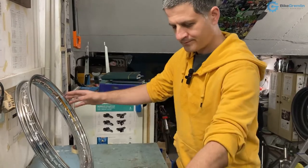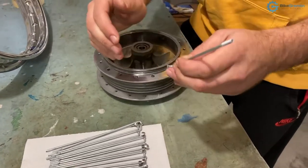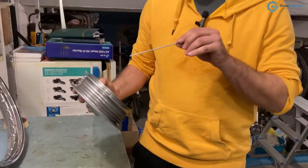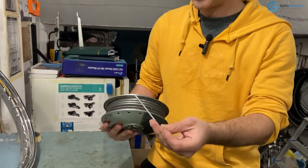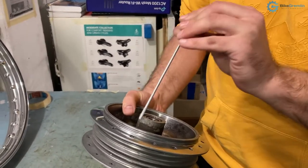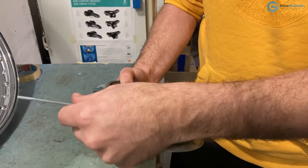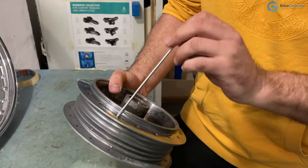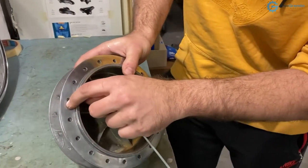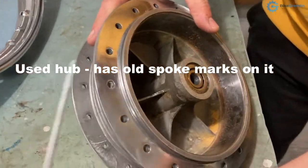Here we have new spokes so I don't have to worry about which go inside and which go outside — that will be formed as I finish building the wheel and do the stress relieving. I will start with spokes that go from the inside, because it's more difficult to start with outside spokes. Later when you need to cross them, you'd have to get the inside spokes between all the outside spokes already there, which causes problems bringing them to the rim — that's a relatively common mistake.